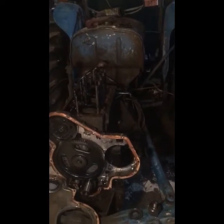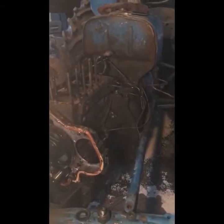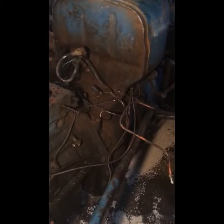That is going to end it for this video. For those who watched the first one and know the problem with this tractor — due to a viewer who is Scottish, by the way, not from England — a really helpful guy who kind of led me in the direction of the governor. I've also gotten that bit of advice from some others. That hose right there goes to the governor over to the air intake side — that hose was completely and utterly caked full. There was no air getting through. That would support the theory that it was the governor that was not working. It stands to reason I could have probably fixed the tractor, at least that problem, by cleaning that hose. But here we are, knee deep in it, we're gonna continue.